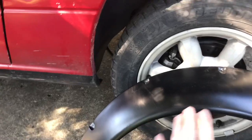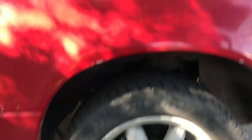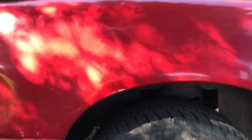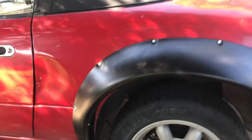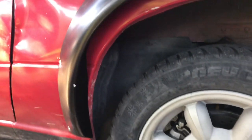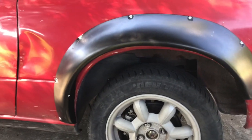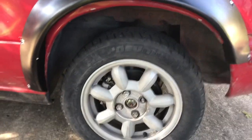We're going to do the same as we did for the first one: offer it up, see where it fits using already Rocket Bunny Miatas as reference, and then run self-tappers, see where all the holes go, draw a line, and then cut. Here's what the back one looks like on — you can see it's all held on with the self-tappers. Now we've got to go up there, mark with a marker where we're going to cut, and then cut it up so none of this lip is in there, and then we can get our wide tires on.